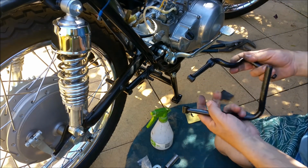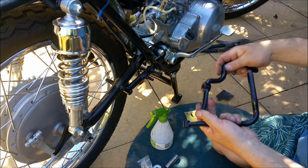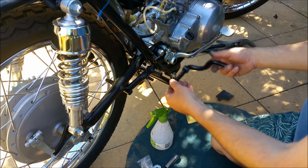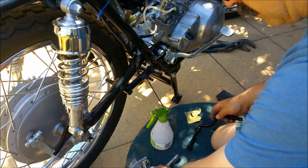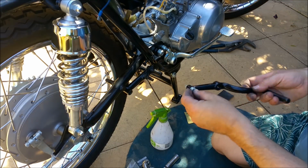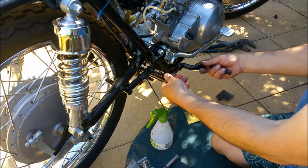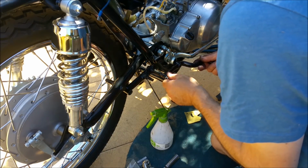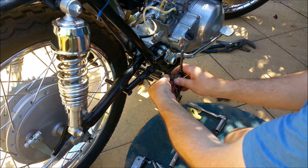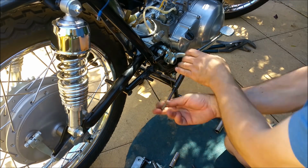There's two foot peg types. Well, two per bike if you like. One with the dog leg, one without. The one with the dog leg actually fits in there to avoid the brake pedal, so we can pop that in. And the original Suzuki hardware, I think, was all domed, but it was all rusted and looked terrible. I did clean this thread up, didn't I? I'm a bit of an idiot because I forgot to do this side. This was the side the frame was sitting against the wall. So I'll just clean these threads up a bit.